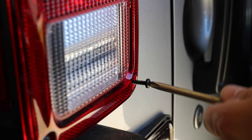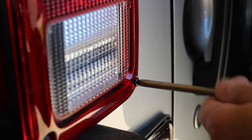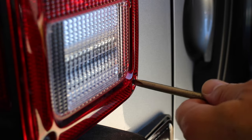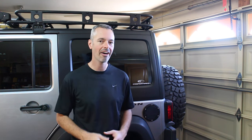Make sure when you're screwing these in that you don't torque down too hard on those screws because if you do they'll actually crack the plastic of the lens. Just nice and snug is all you really need — make sure you get a nice seal. So that install went pretty well, except for that black O-ring — that thing was kind of a beast getting out and then putting it back in to fit right. I busted my knuckles up a little bit, but that's okay. Overall, not a bad install for an afternoon.